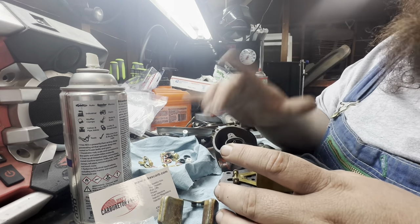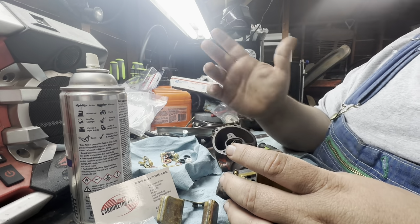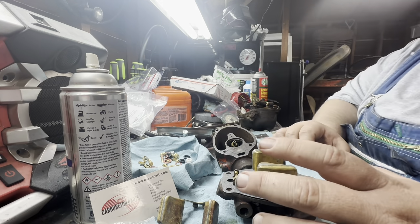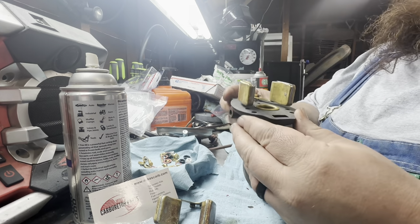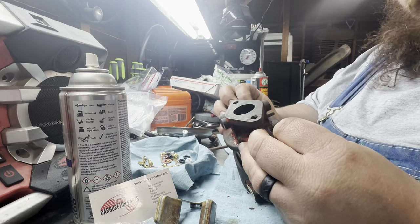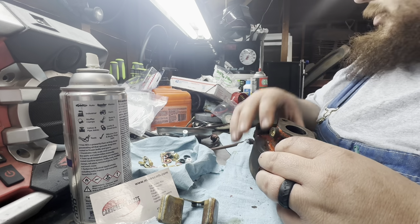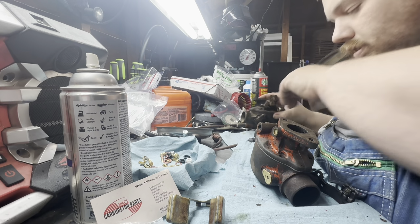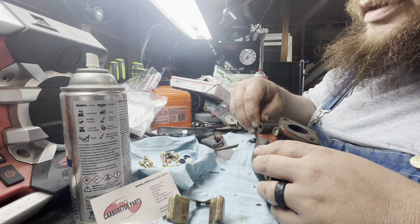On a downdraft carburetor, like what's on a V8, if you leave your fuel pump on and this float's stuck, it'll fill the motor up, because it'll pump up and over and go down in the intake, and next thing you know, you'll hydrolock a cylinder full of gas, and that's a bad time. So it's important to have that thing set right, because if it's not set correctly, it's not going to run real well. But the tractor guys have it a little bit easier in setting them up versus the automotive ones, we'll say.